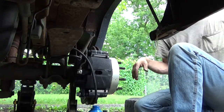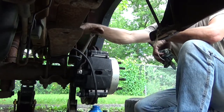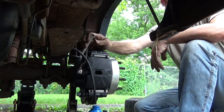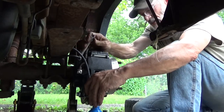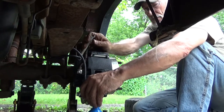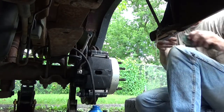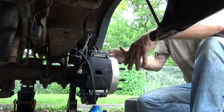Seeing as you're here, you want to do me a favor? Put some pressure on that pedal. Let me know when you're holding it down. Okay, go ahead and let it back up. Pump it twice. Okay, holding it down. Pump it again. Hold it down. Yeah. Okay, we're done. That took care of the end of the air. Now go ahead and pump that pedal good and hard. Make sure that holds. Okay.